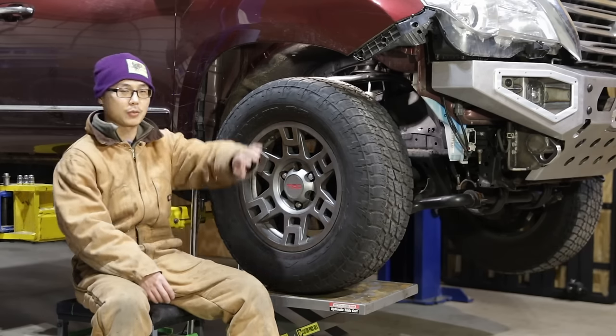We just talked about extended travel coilovers, which are mostly half an inch longer. Now what about simply adding a half-inch spacer on top of a standard coilover — doesn't this essentially make them half an inch longer? We'll take a closer look in the part 2 video. We'll also look at spacer lifts in general, which have a very bad rep on the internet, but not all spacers are equal — you just need to understand the why and how. We saw how much suspension travel the Toyota IFS is capable of, but that was without a coil spring. How much articulation can we actually get with a complete suspension? We also learned how lifting the ride height reduces down travel — but how does that manifest in actual articulation? Would the vehicle just start using more up travel, or would there be a net decrease in total articulation? I prepared some detailed corner travel index tests to simulate a realistic cross-axle situation during off-road, with a direct comparison before and after the lift.